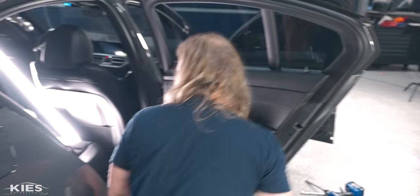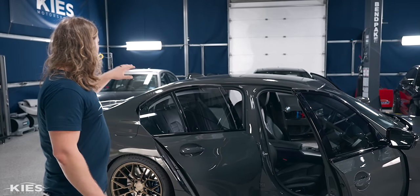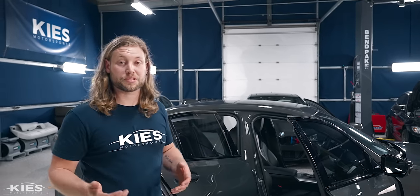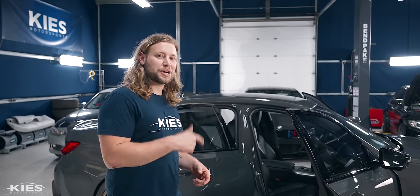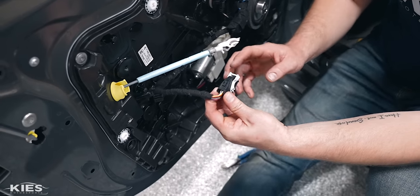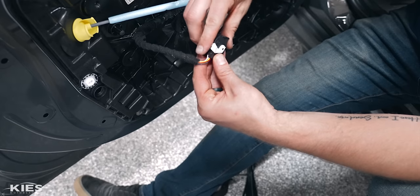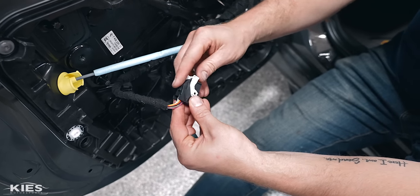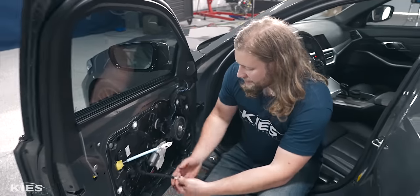At this point you know how to do a front door, a subwoofer, the dash speakers, the deck, and the rear door — there's pretty much nothing you don't know. Everything is pretty much mirrored on the other side; we're not going to walk through every single door step-by-step because that would make this video two hours long. Off camera Zach helped me finish the remaining speakers. One note for the driver's door: it has a cam-lock style connector — press the button, work the clip out, then when reinstalling, push it in as far as it'll go and push the cam to lock it in place.